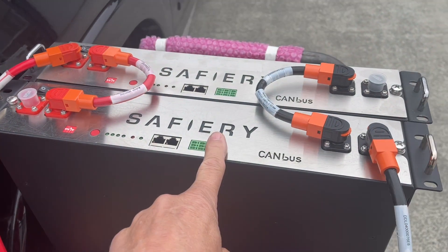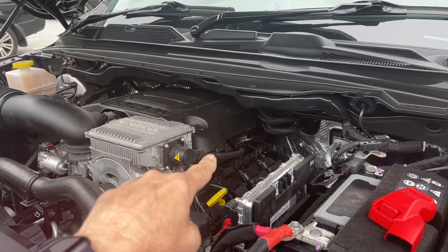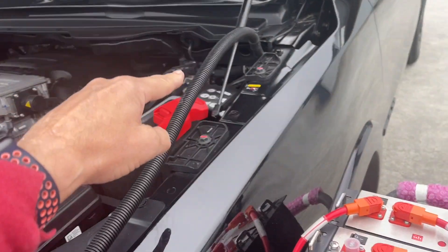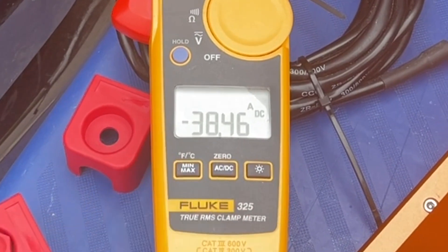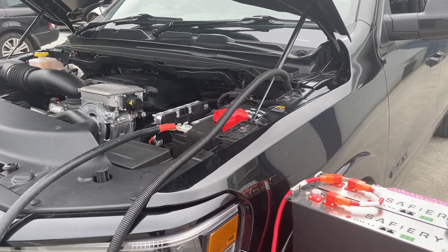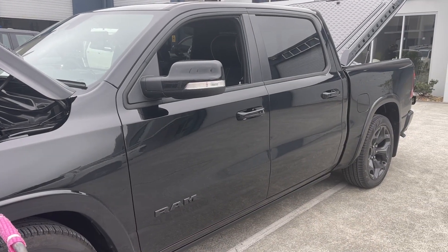That's coming out and charging the two 48-volt batteries here. The DC-to-DC on this vehicle is published at 3 kilowatts, so I can pull 2700 watts out of it on this side. Just turn off the cam and you'll see — when we turn it off it'll just collapse down to nothing. And that means we've solved the problem with the 1500s. In my opinion, we'll get 2700 watts out of this — how good is that!